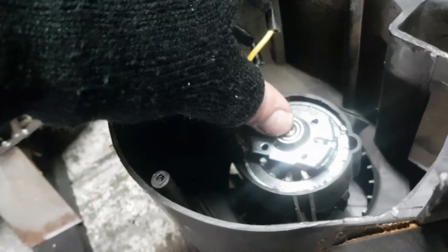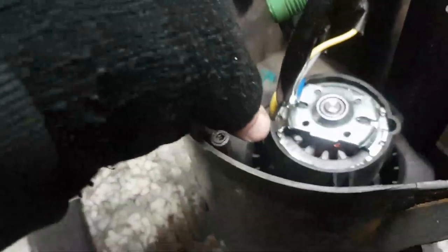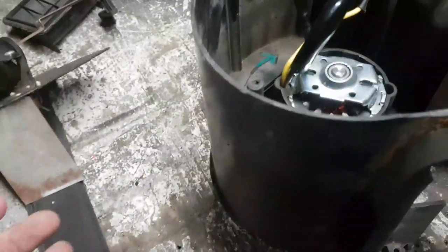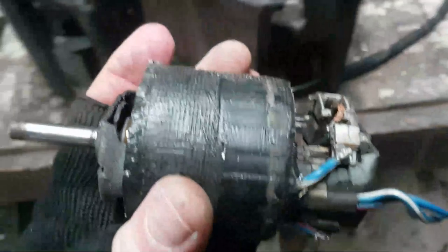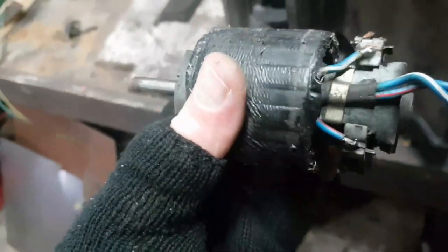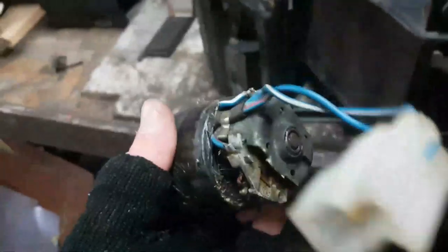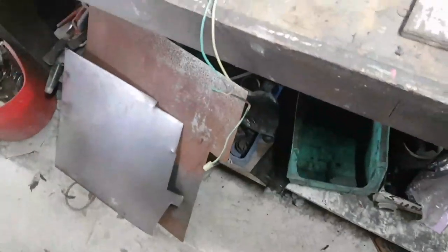So you can put this thing in one of two orientations. I've got the cable running up the outside of that side, and not this side. If I do it the other way around, then it doesn't mate properly on here. The other slight issue is that, because of the ham-fisted previous installer of a fan motor into this heater unit, they've broken one of the catches on the front, which is why they've wrapped duct tape around it and then wedged it in badly.